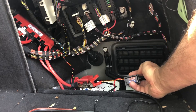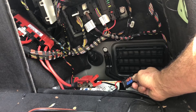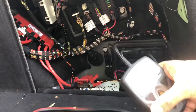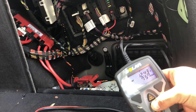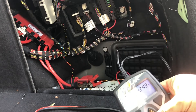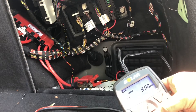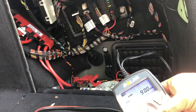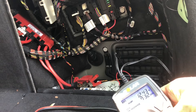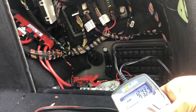So you can see it shows the voltage — 12.3 — and 0.00 is actually the amperage, the current. It's only connected to the positive and negative terminals. This is a pretty interesting tool: from the beginning it shows you the battery voltage, and then you can press this button and it shows you the CCA — which is cranking amps — and you can test how the battery is. It shows 732, which is not that great but still okay for a three-year-old car.